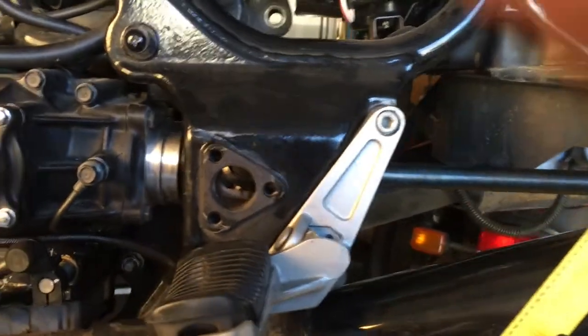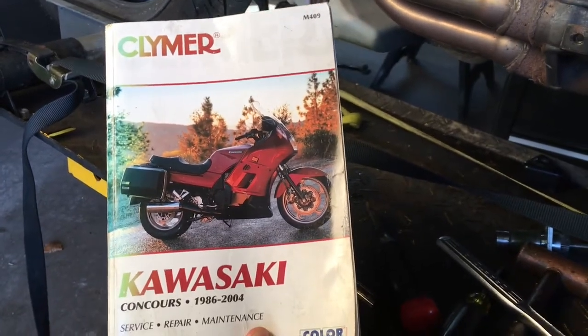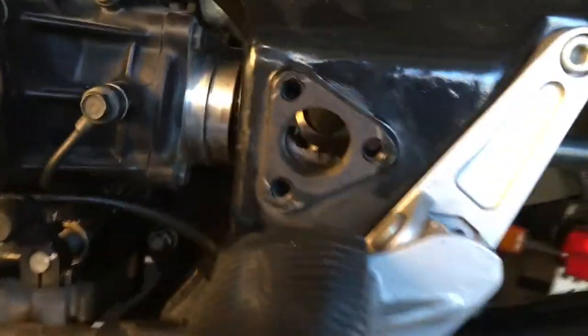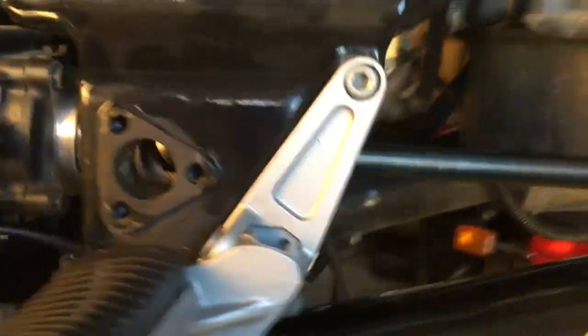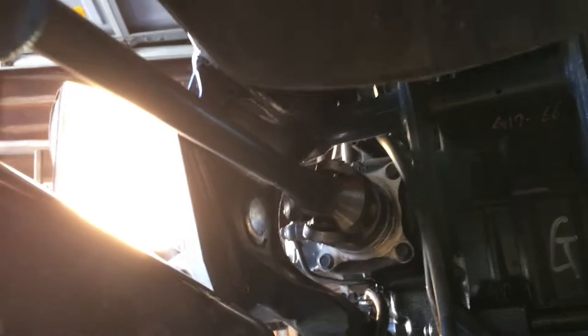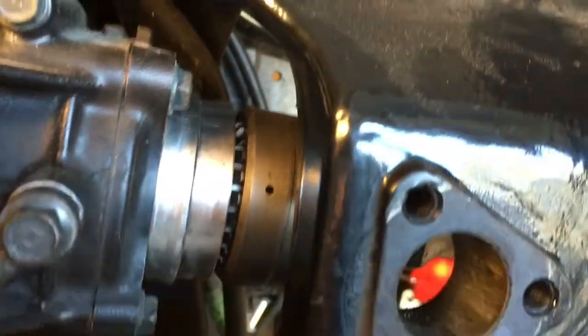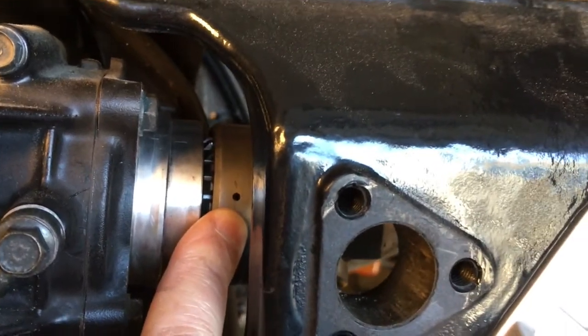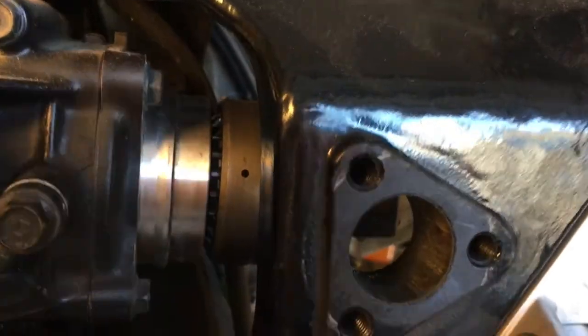I have the swing arm off. I took out the pins. By the way, I'm using the Clymer manual for all these procedures and you'll need that. Both swing arm pins out, the boot had to be unclamped, and I had to take out the shock absorber because it goes right through the swing arm. Then you pull it all back and it leaves this naked drive shaft, which I have suspended. Now I'm going to put the camera on a tripod to film the procedure with this spring-loaded pin that's apparently in this hole — when pressed down, it releases the drive shaft from these splines.